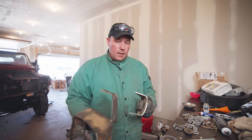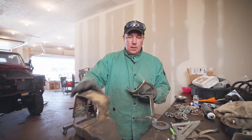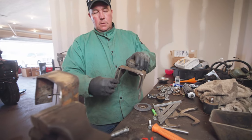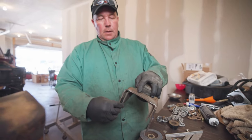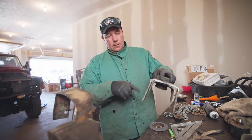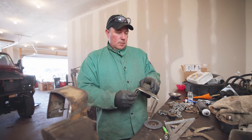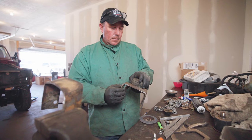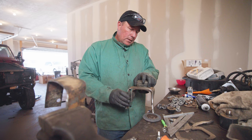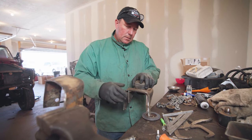The reason I cut that off — this is actually the rear cab mount, which was extra — so I cut a piece of that off and I'm going to use it to extend the front mount so it actually reaches the frame. It takes care of a couple problems: it gives me a lot more to weld on to the frame, extends it down and that way. We might have to cut this in the middle, cut maybe a quarter inch out of it, weld the middle back in, and that way it'll fit snug on both sides and make a nice weld.